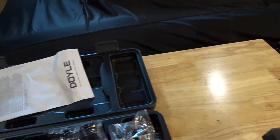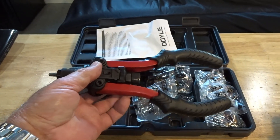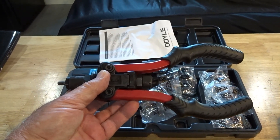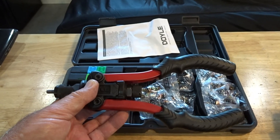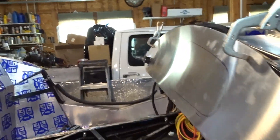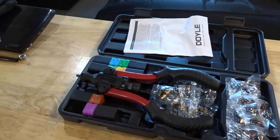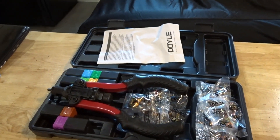I mean I've got pretty big hands, but this is quite a bit bigger than the tool that it replaces. So I've got it set up for quarter-20 nutserts right now. I've been using a lot of quarter-20 nutserts in Michael's car — I used the quarter-20 nutserts to attach the Holley to the backing plate right there. And I've used it for quite a few other things on this car so far, and for putting some of the removable access covers — like for the fuel pump and the fuel sending unit in the trunk — we'll be using this tool as well.